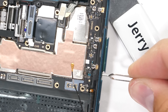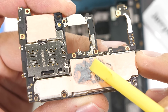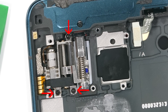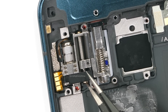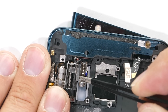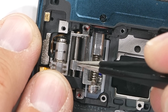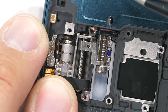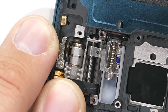Then I can remove the dual SIM card tray, and the motherboard can lift out of the frame. It has some normal thermal paste on the back, which helps transfer heat to the metal frame of the phone. The small internal motor of the Oppo Reno has three tiny black Phillips head screws holding it to the body. I'll gently lift off the four square contact pads that power the motor. The motor on the left turns this threaded shaft, and as the threaded shaft spins, the stationary metal chunk gets screwed up and down the shaft, raising and lowering this piston-looking rod, which is attached to the base of the triangular pizza camera with one little screw.